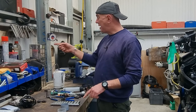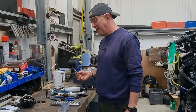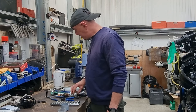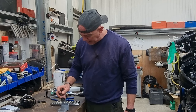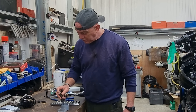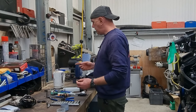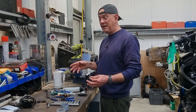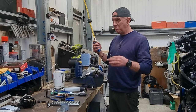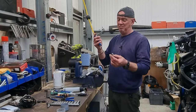So it's a 50-50 mix of that and water. You clean everything in acetone. I'm not supposed to be touching it with my fingers, but I don't really care. They're not going to be in there that long. And then basically you just dunk it in that for a few minutes, and it basically goes black. Takes about 3 or 4 minutes or something, just for it to properly do its thing. And then you rinse it off with fresh water, which I'll have to go and get. And then you just dunk it in any oil. Any oil, it doesn't matter. It could be 3-in-1, it could be gearbox, or it could be anything. But the oil, as I understand it, goes into the layer that the bluing puts on, and it just gives a level of protection, basically. It also goes black. I don't know why, but it goes black.